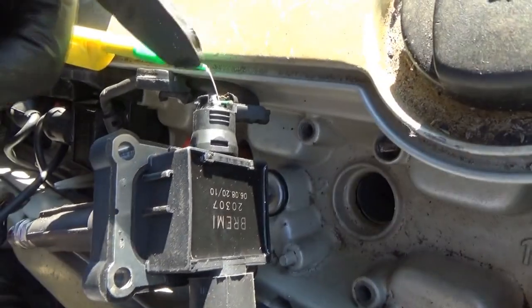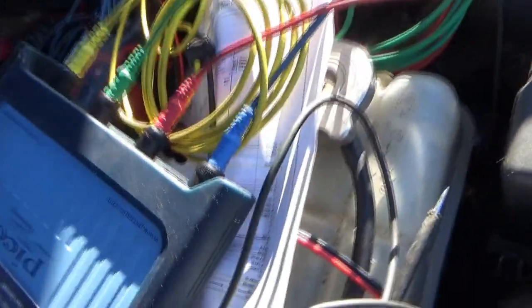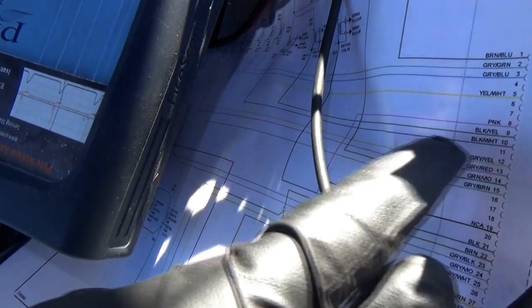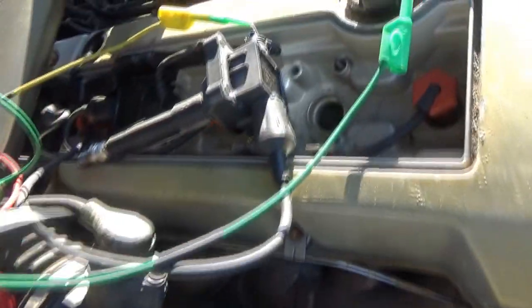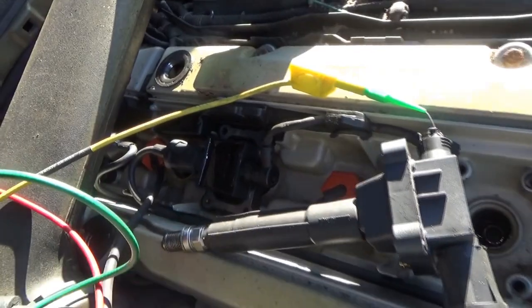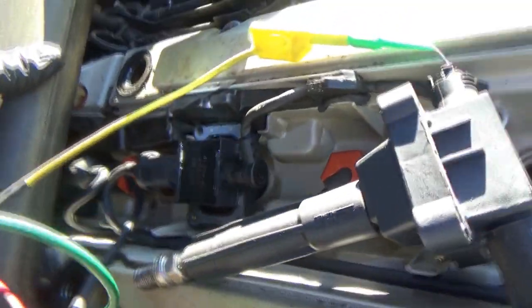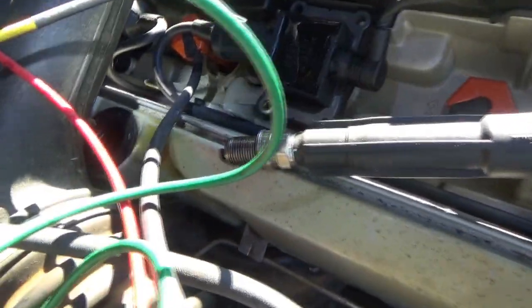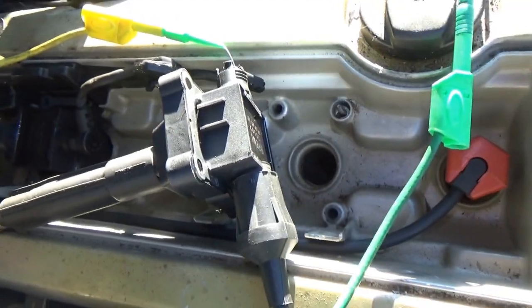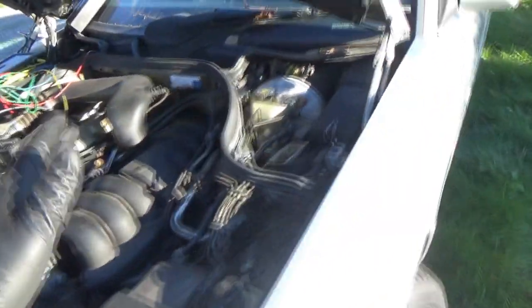Black and red on pin 9 — it's actually ignition coil 1 but it controls spark plugs number 2 and 5. The companion pairs are: 1 and 6, 2 and 5, 3 and 4. Brand new coils, brand new Bosch plugs — everything should be good. What I want to do now is just unplug the cam sensor and see if the computer's strategy allows us to at least fire this engine without the cam sensor.